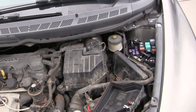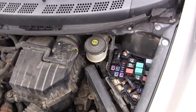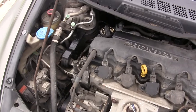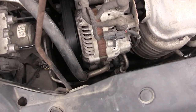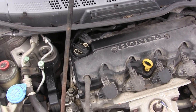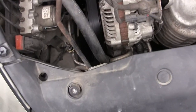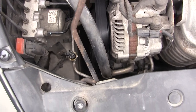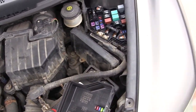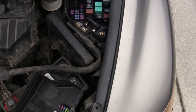2007 Honda Civic LX. Intermittent AC, clutch pulling in intermittently. The other day I put in another pound of refrigerant, and about a year ago I'd put another pound in, with the stop leak and dye marker. I want to check out this three-way switch down here with a digital ohmmeter later, but reports say the intermittent problem is caused by a funky relay, so they say swap the relay out.